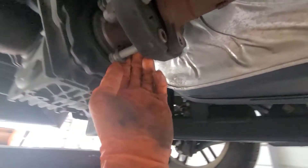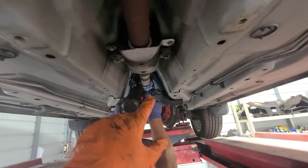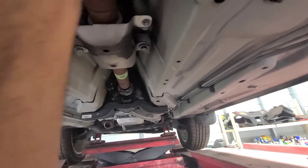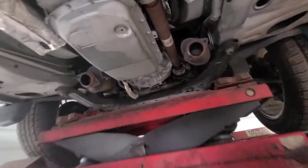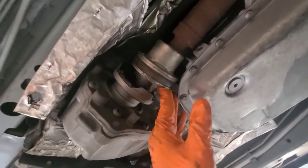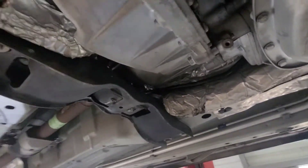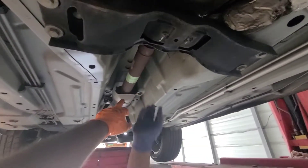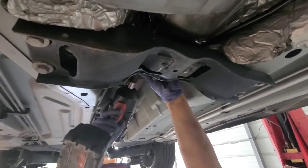So we have this bolt off — they did not come off fully all the way, so they're just gonna sit there. We're gonna be taking out the driveshaft over here and then the centerpiece right here. We already loosened up this one — you don't have to take it all the way out, just let it loose so you can take the crossmember off and the transfer case.